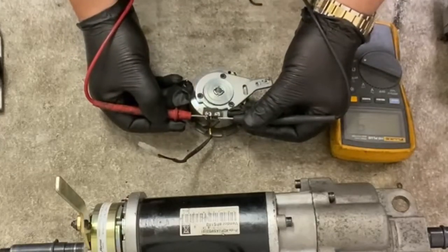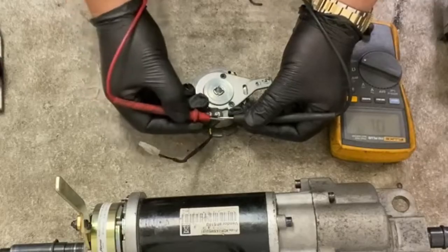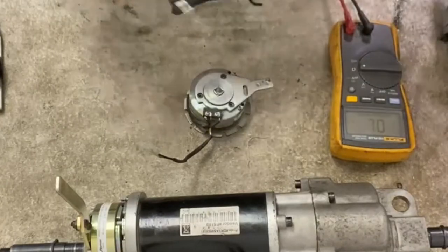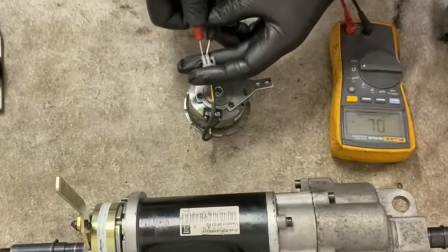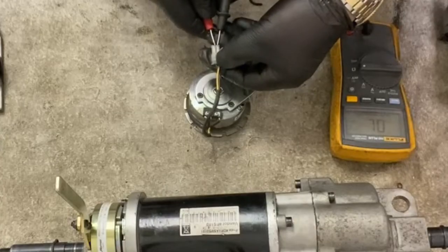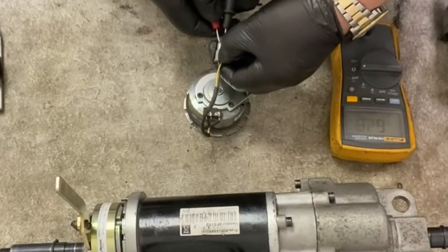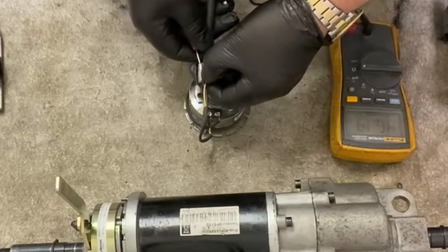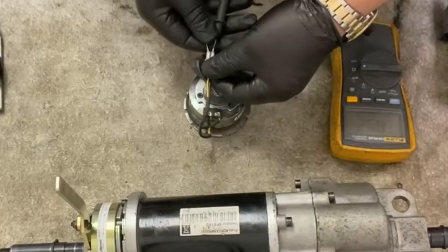That's telling the brain of the scooter that it's open, or it's closed, sorry. So you've got continuity between those wires, made a circuit. And the way you test to see if your brake's any good, you put your testers in there, and it should read when it's in the closed loop position. It reads 61.7, so it should be reading around about 59 to 60 ohms. So you put it in an ohm reading and it should give you an ohm reading saying that yes, you have a circuit, so the micro switch is working and also the brake is working.